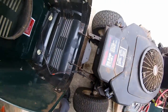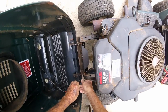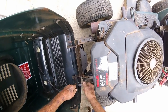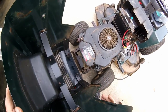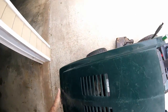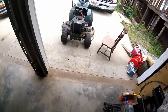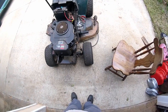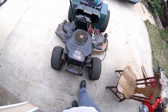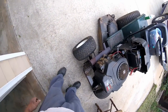To go any farther, I'm going to take the hood off this thing. It's just a matter of unplugging this wire, tilting it at about 45 degrees where it'll lift past that bracket, and lifting it off. That'll make it a lot easier to get to. I don't know how that bracket got bent in the front there, but we'll straighten it up before we put it back on.